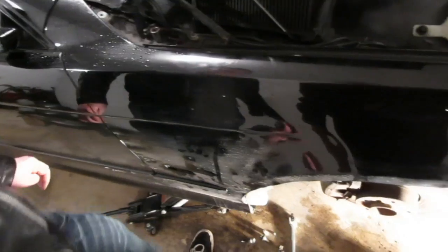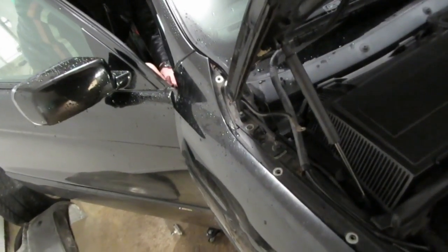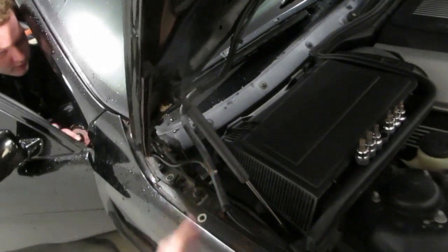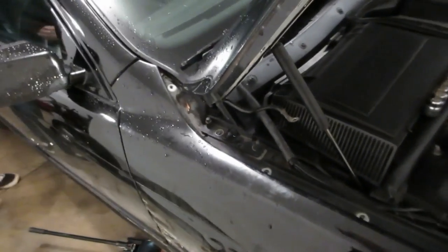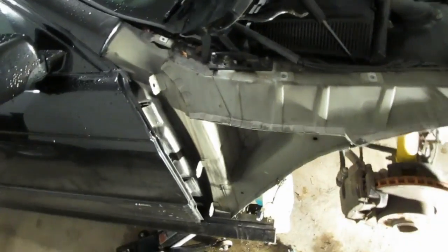The entire thing should be loose now once we loosen up the hood latch. There's one more bolt we found inside the actual door — it's a 10-millimeter. As you loosen that, the only thing holding the fender to the car is the hood and one of these 13-millimeter bolts. I would recommend you get some sort of hood prop — and the best hood prop is another person to hold this side up. If you take that bolt out, bad things will happen. So be very careful when you remove it — keep in mind this hood probably weighs a good bit. With me holding the hood and him removing the last bolt, we were able to just slide the old fender right out, take it off, and put it on the floor. It's actually really light — doesn't weigh very much at all.